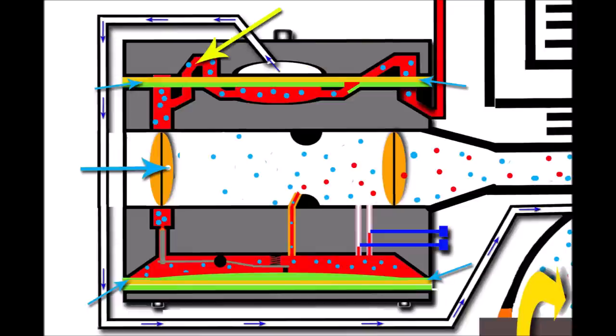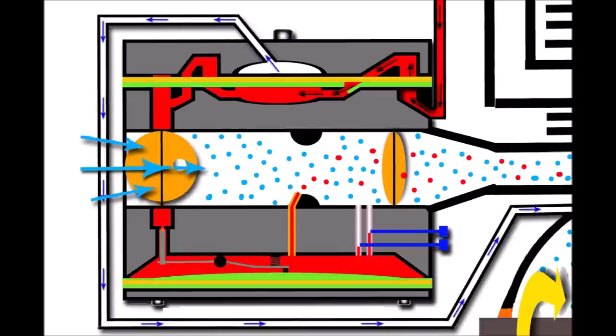The poor flow of fuel and air coming down through the carburetor gives the same sort of symptoms already described, but the double whammy here is that we already have a problem way before the fuel gets down to the metering area. Providing the cap is only slightly loose, it might seem that applying the choke will help, but as always this isn't the rectification. The answer is to either tighten the cap or replace the gasket or seal.